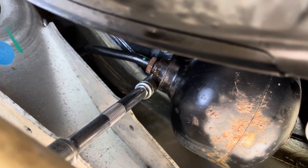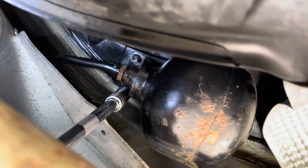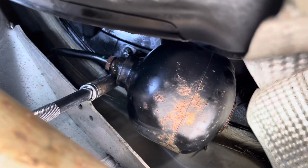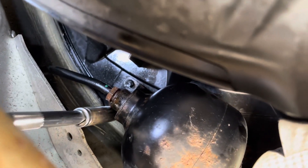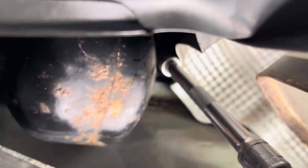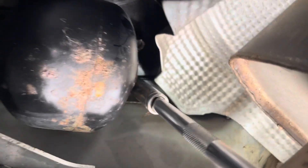Take a super long extension and go inside there and unscrew with the air tool. Take out the two screws here and then there's one hidden right behind here — you need to get to all of those. Use a really long extension to get up in there and take the bolt off. It doesn't come out too easily but just keep trying at it. Remember those are 13mm, both of them. Now you have the one in the rear right there — take that out with the 13 millimeter also and unscrew that off slowly to remove it.